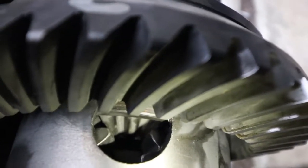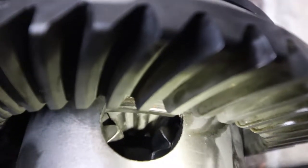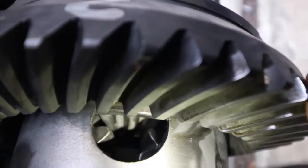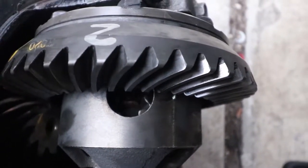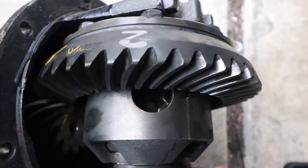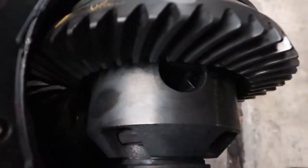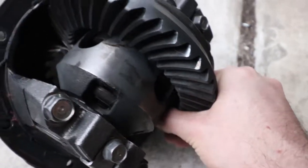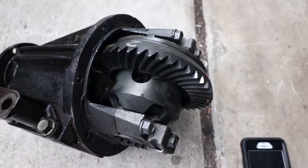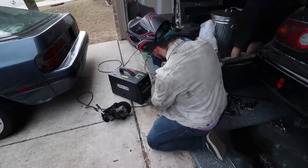So if you can see in there, there's a couple of gears that we're going to try to weld together. This is going to be kind of tricky — I've got to be extremely careful not to weld past where the splines are going to go in. When you're under here, I'm putting my finger in through here, and you can see down there there's a pathway — you don't want to be dropping weld in there because that's where those things go. We're going to do one, then turn it and do the other one, and so on and so forth. Sure you want this? Because there's no going back. Just do it — time to cook us some diffs.